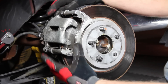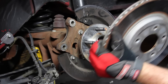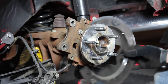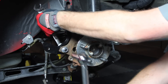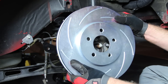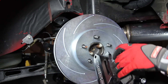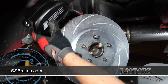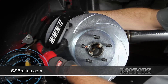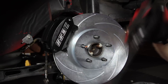The rear brake upgrade is similar, but you'll need to install a mounting bracket to the inboard side of the axle, securing it to 65 foot-pounds using the supplied 12mm nuts and bolts. You'll also need to relocate the parking brake cable using the supplied L-brackets on the lower caliper mounting bracket bolts. After repeating on the other side, have a new bottle of DOT4 handy and bleed those brakes, keeping the master cylinder at least one-third full. For more information visit SSBrakes.com.